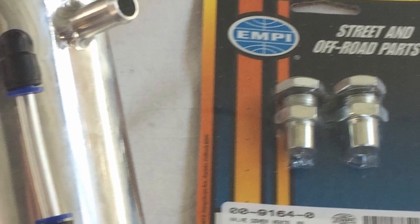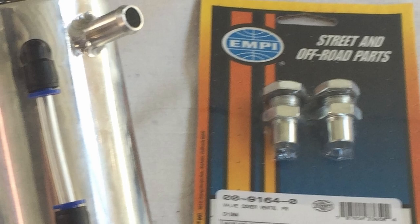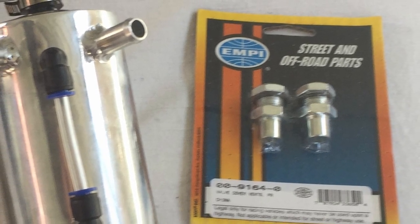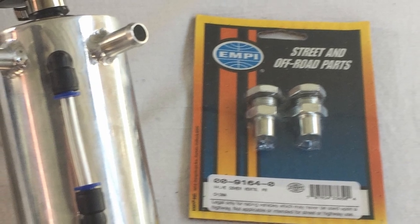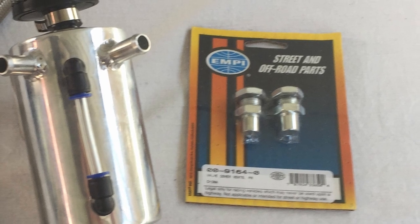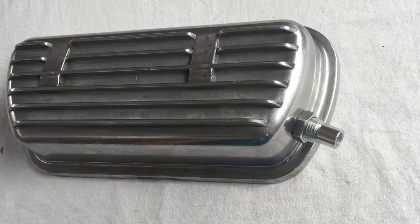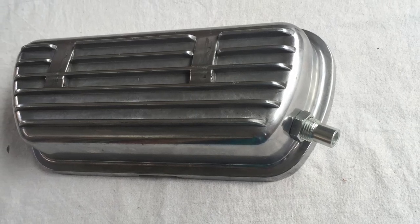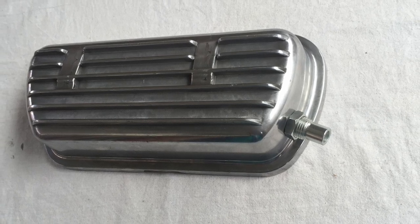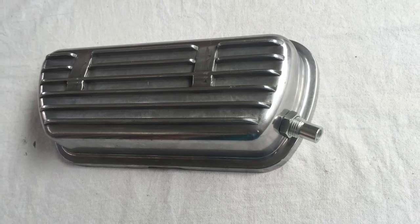So this is how I'm going to fix my crankcase ventilation issue. I'm going to fit a catch can — which is what you see on the left — to vent the crankcase, and I'm going to fit those vents on the tappet covers to allow the pressure to vent out of the tappet covers as well. Here I've installed the tappet vents into the tappet covers. These will then get installed on the car with a tube up to vents which allow the gases to escape out of the motor.